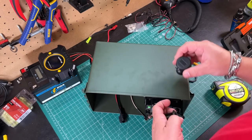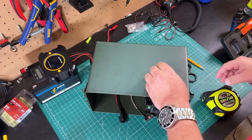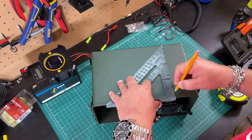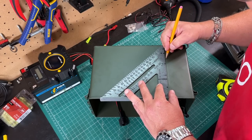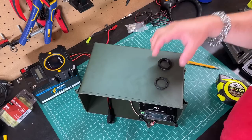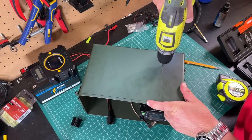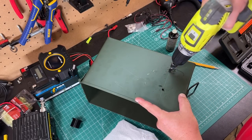Next I need to drill a couple of holes here for our power poles and USB outlets. I'm going to keep them centered over the radio — thinking about two and a half inches out, should be pretty good. So we'll make a mark, go down two and a half and then five, and that'll be our center — nice and evenly spaced. Again, I'm going to drill some pilot holes and then use this big massive step bit to open them up. I'll start with a smaller step bit and gradually open this up.